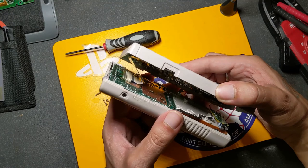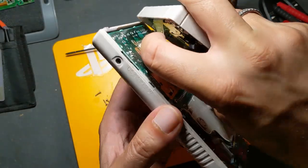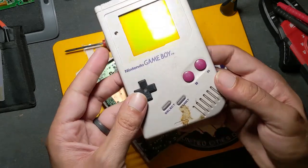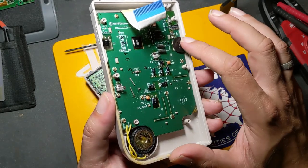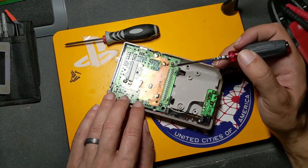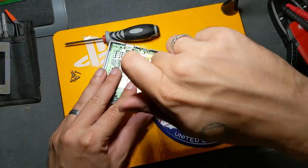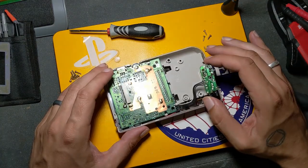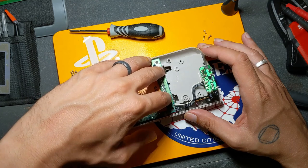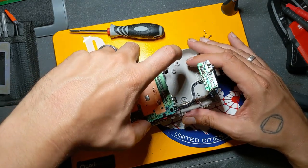When you separate the case, you want to be careful because there is a ribbon cable connecting things. You're going to need to slowly and carefully unseat this connector by simply pulling it straight out. We'll probably have to deal with this a little bit later — given the condition of this thing, I have a feeling we might have some things to take a look at over here. For now, we'll just put this aside. To get to where we need to go, we have to remove four Phillips head screws — two on the top board and two on the headphone board. We're going to carefully lift the board out from this side, because the power inputs for this board are attached here and here — they're going to pop right out from the plastic.